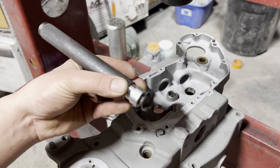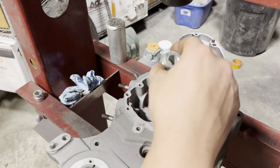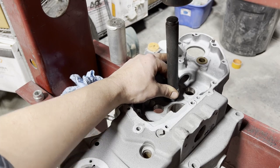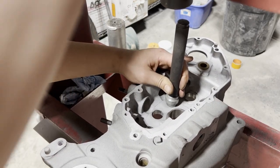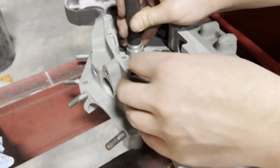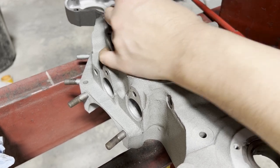I'm going to get a bigger driver and I'll explain why. All I want these bearings to do is flush up with the case itself. If I use a driver smaller than the diameter of the bearing, I can actually push it too far — which I'm trying to avoid. It helps if you plug your bottle jack or close the valve. When doing this you do want to make sure your case is supported on both sides and level. Keep an eye on your dowel pins, letters out, square this up roughly in the bore.